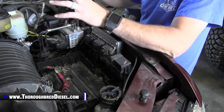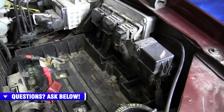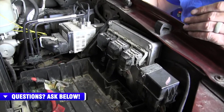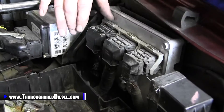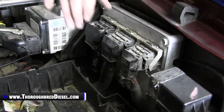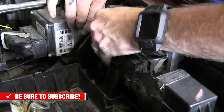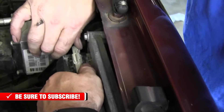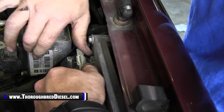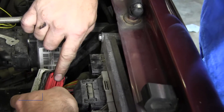We're at the driver's side of the truck now and going for the PCM connection. I took the battery out of the driver's side — it really makes this job a whole lot easier. Now I want to show you pulling the plug out of the ECM: which plug to get and the wire you're working for. When dealing with the ECM or PCM plugs on these trucks, in the very center there's a latch. All you do to disconnect it is push backward on the latch, and that's going to make the bail trip automatically go backwards. As you're pushing the bail trip back, make sure you put a finger on both sides because they can be old and brittle and they can break — you won't have good seating of the plug and it could cause tons of electrical issues. Thumb on both sides, continue to push back, and as you push back it's going to roll the plug out itself.